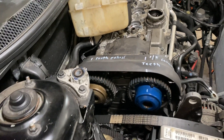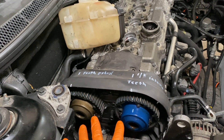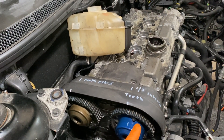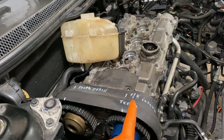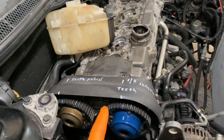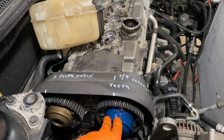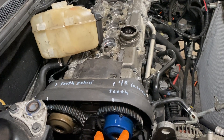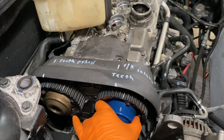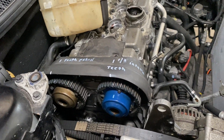This video is about aligning the valve timing — not when you're doing a timing belt. When you're doing a timing belt you could probably get away with making marks on the original position, take the timing belt off and you'll be okay. But if you're replacing the head gasket or you're taking the variable valve timing gears off — to let's say replace the seal in the back — there is no key way here, and these move. They have to be locked in a certain way or the engine is not going to run right.